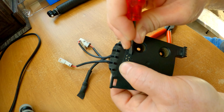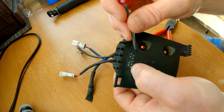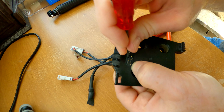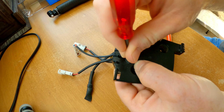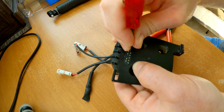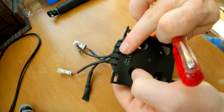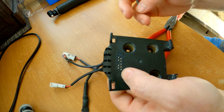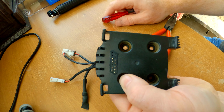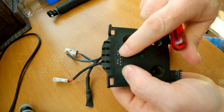Like on the XR650R, I don't have everything hooked up. So if you knew what each pin was, or wanted to trace it to where it's going, you could take one of these pins out and sacrifice it — swap it over — without buying another mount. I think having power is more important than maybe having engine bike temp. It's up to you. Just make sure that's sealed. If you had the dielectric grease in there, everything's going to be sealed. And there we go — we have the pin and it works. That's all you have to do.